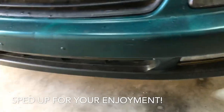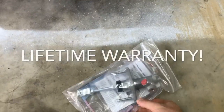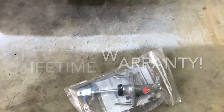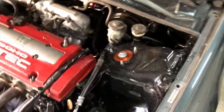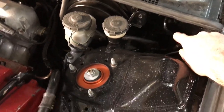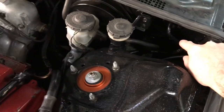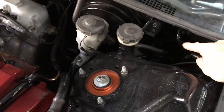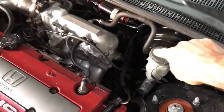Today we're gonna go and replace that with a new clutch master cylinder. I went to my local auto parts store and bought a Duralast clutch master cylinder — that's what it looks like in the bag, brand new. This part goes through the firewall, and this is where your hose connects to go to the reservoir. We're gonna be installing that today. It's situated right down in here — I painted my bay black when I was repainting my engine bay, so it's very hard to see, but it's down there. And this is just your reservoir here.